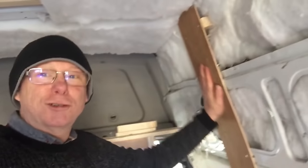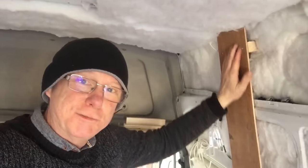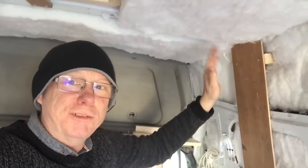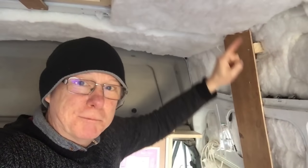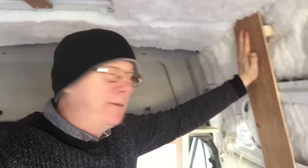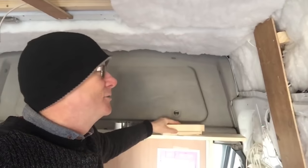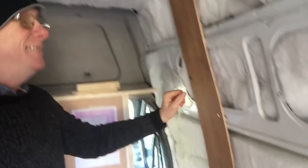This is what the batten looks like when it's up — as you can see, it's nice and parallel. The little step I've made is absolutely the perfect height away from the side of the van, so you've got something to attach the top to, otherwise it would just be floating around. In my opinion, this is the best way to do it — these two pieces of timber make the perfect height for the step to attach the top of the batten. Nice and straight, nice and parallel, and perfect for putting the cladding across the top.